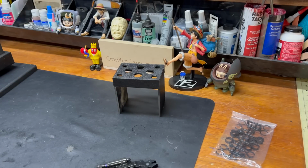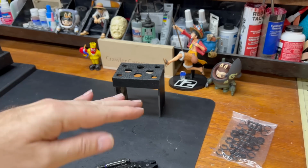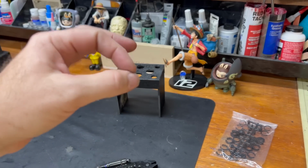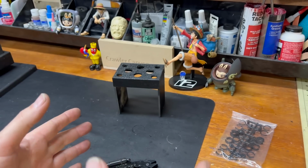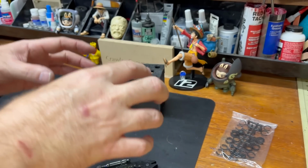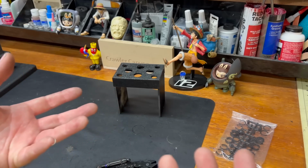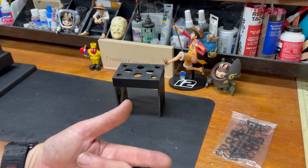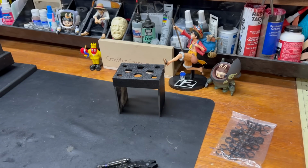So that guy is tuned like that because I'm sacrificing some ability to damp at the extreme for overall compliance. Like, he will lift a tire, but he's going to keep good ground contact with big flex. And like I say, he is very situational. So no one else is going to be set up exactly like that. We do one-on-ones around here.